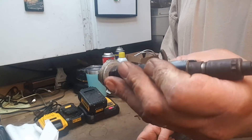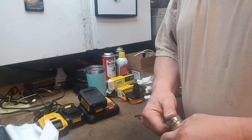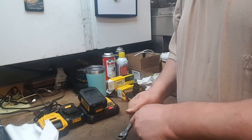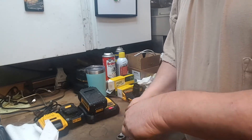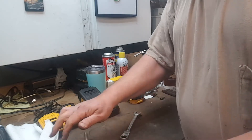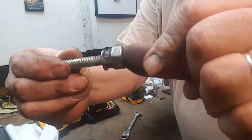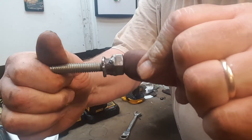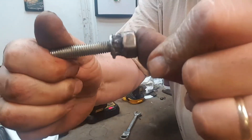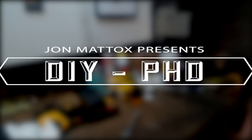There was nothing else I could use. I found a couple of other online tools — one from Yanmar stated to use a slide hammer. The problem is working on some of these tractors, the gas tank sits over the top and you don't have the room. I did this with my stick welder and you can see where I ground just a little bit to get that in there. Worked like a champ.